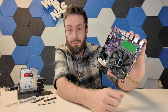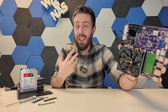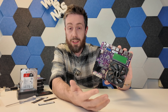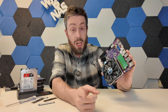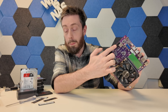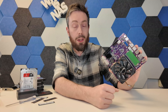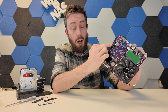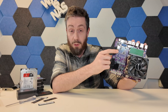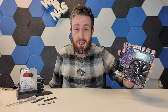The memory: I installed my own 8GB DDR5, but keep in mind this board does not feature ECC. Not a deal breaker for me, but it may be for you. Also, if you put a 10GbE card in the PCIe slot, the SATA controller — that ASM1166 — is on a Gen 3x1 lane, so your SATA ports are always going to be throttled to around 880 MB/s regardless, even though the PCIe slot itself is 3x4.